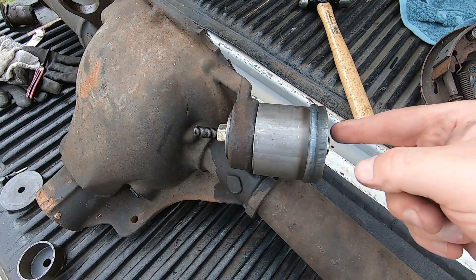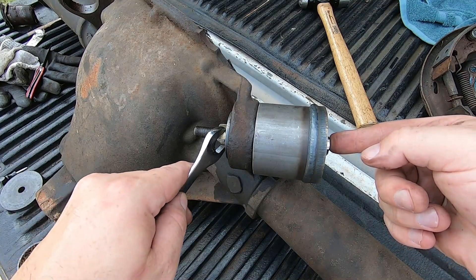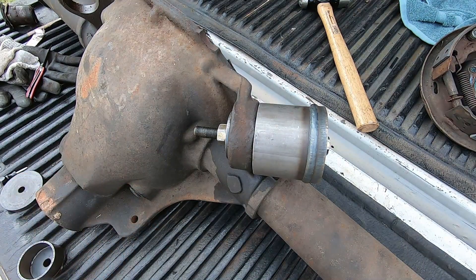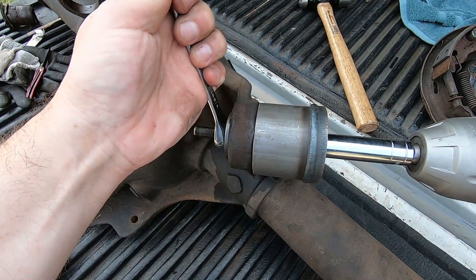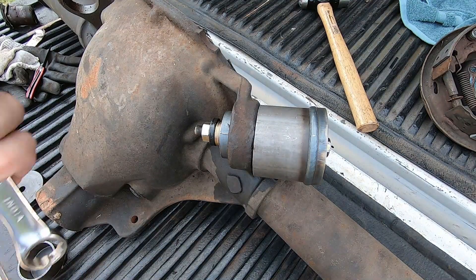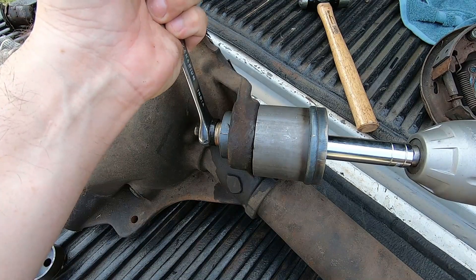Since I ran out of thread, I'm going to have to reposition the bolt. I'll back this out, stack some washers up under this nut so it gives me more room to pull out, and this thing should fall out here pretty soon. All right, now it's repositioned — let's start over.